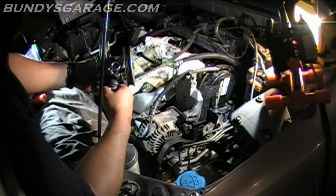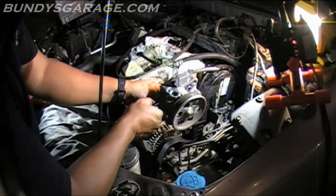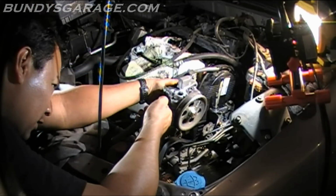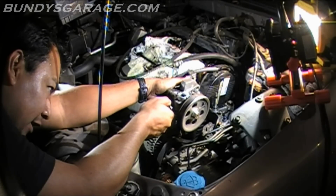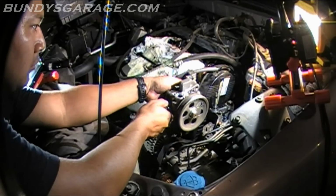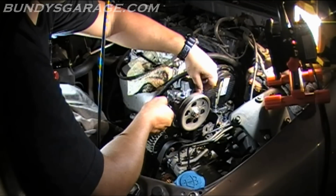Let's bring the power steering pump back in. This bolt goes right here. This is your adjuster bolt. The other one goes right here, so let's connect this one first. I'm going to put a little bit of oil on this one. Line this bad boy up. Trying to start it here. Sorry I can't get a shot of it, but I'm just trying to thread it through the bottom. I believe I got it. Okay, I'll start this one. Line that in straight. Start it by hand.